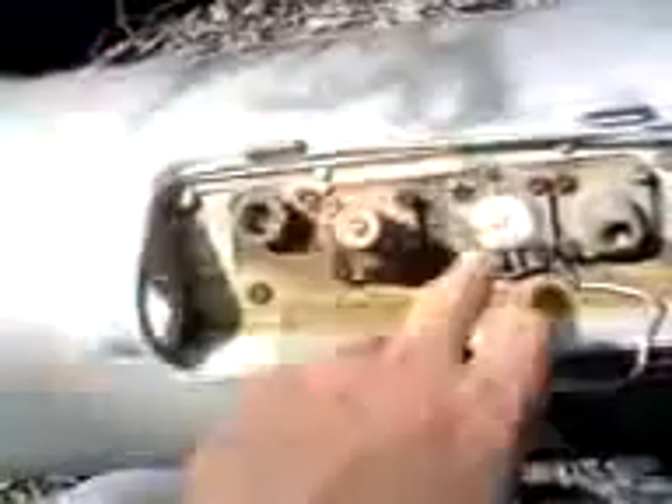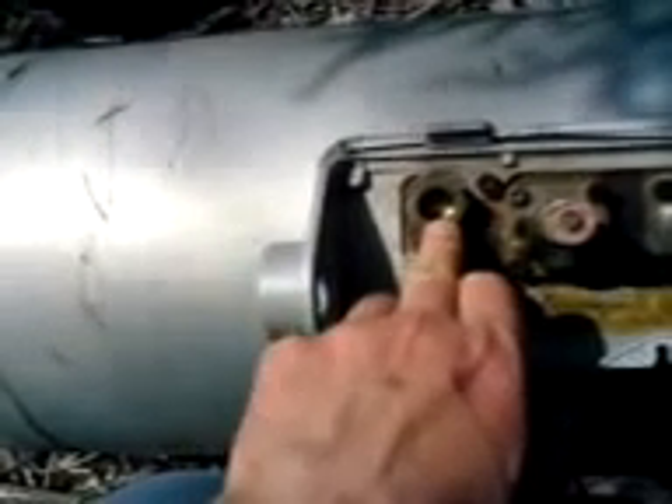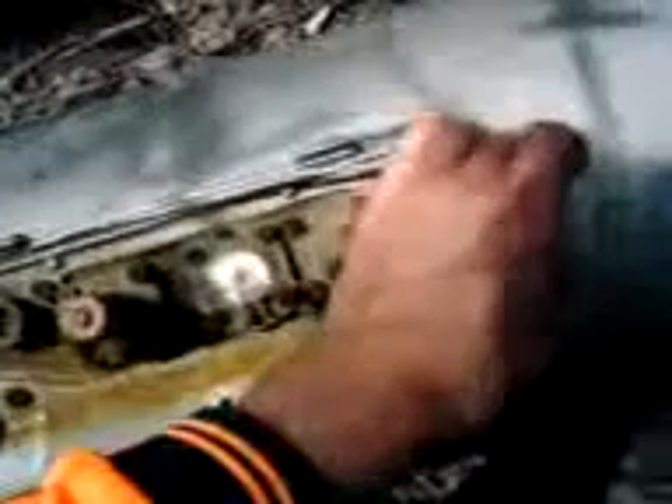I know all my taps and knobs on these. They have a magnet inside which mounts under the other side and moves the needle - this will come out completely clean and clear and you'll just have that bracket with a magnet that adjusts it. That's your inline 3/8 NPT - that's your line that goes to the front of your car. That's your overpressure line. If you've filled it right up and there's a very hot day, the gas tries to expand out a pipe on the side and out to the bottom of the car to release any gases. I've been there when the forklift released one of those twice in about 20 minutes because it was a hot day.